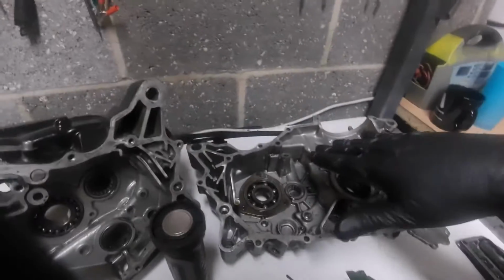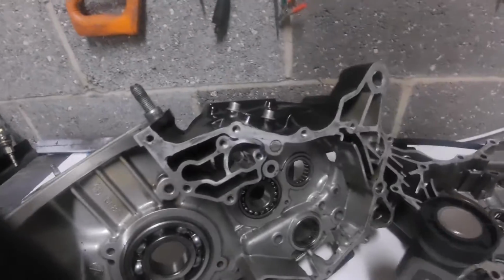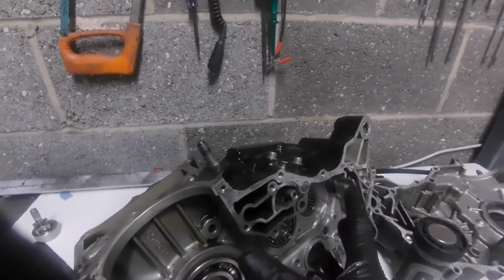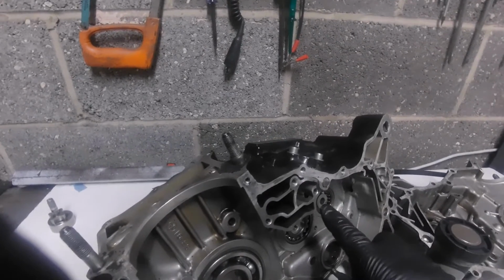So we've had a grinder go in and chop off that section there, which meets up with that section there. What we've got now is pressurised oil coming out of here and not going out of there, as we said. Try and stay with me on this. Not going out of here. On the scavenge side, it now goes into there and through there, which essentially, because that now doesn't match that, will just poof out of there. That's quite a big hole, that, to do that.